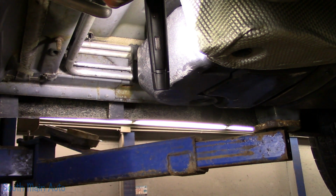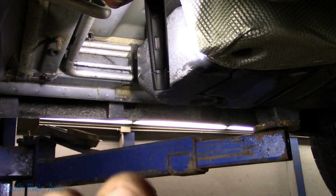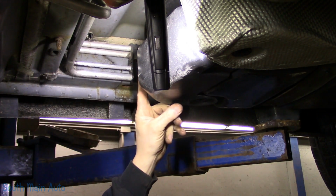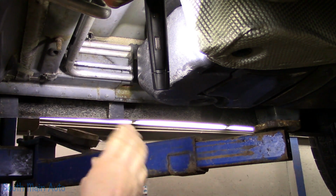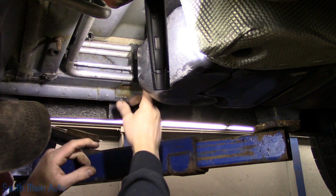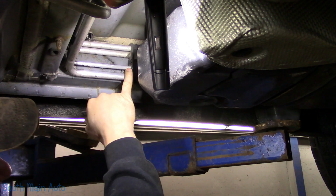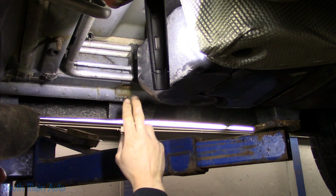And so it begins. What I'm thinking. So the tank, it may be kind of different how you guys see it on camera, but it's only about, well, that's my fat finger, that's my crooked finger. It's about a crooked finger's width behind here, and then it gets snug as a bug in a rug the further back you go. So I don't think, because I'm gonna have to cut the line back, what we're gonna find is a pinhole obviously behind the bracket here. And so we effectively have to cut that piece out.